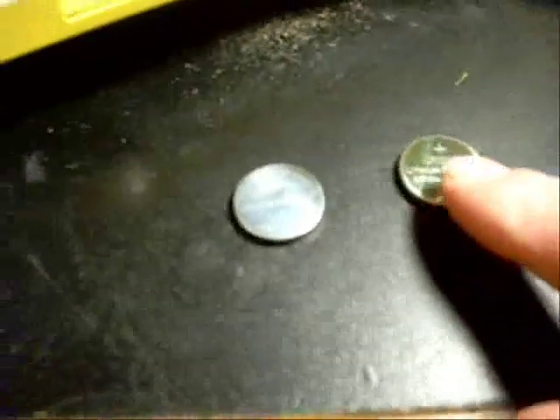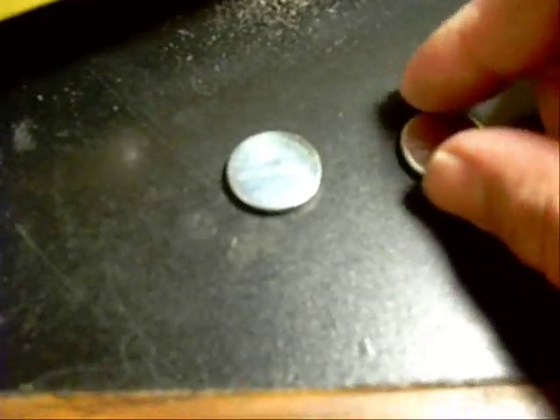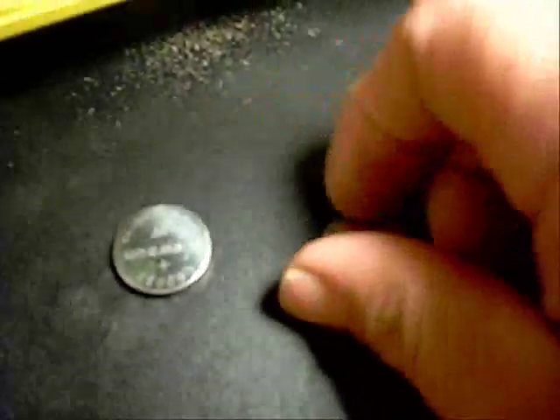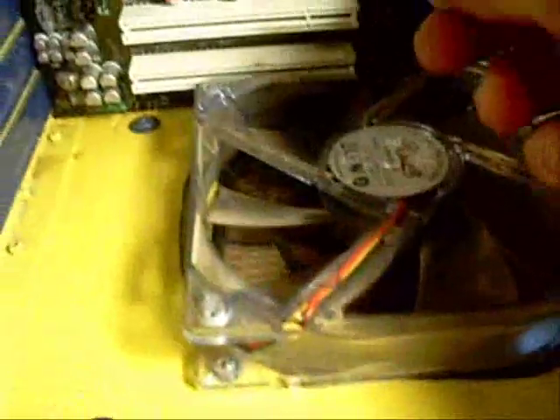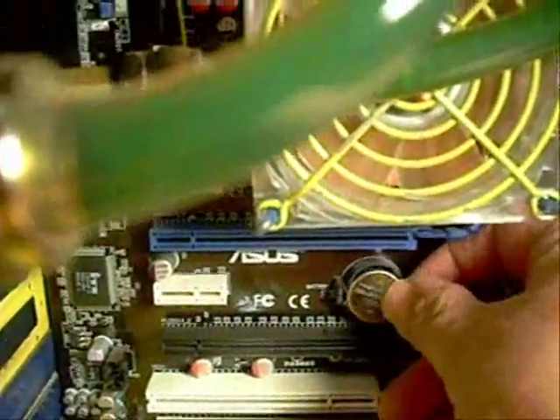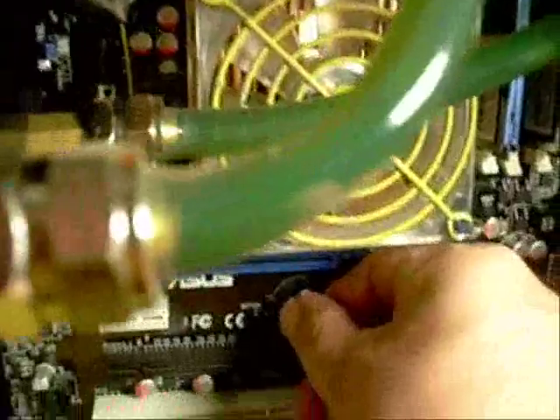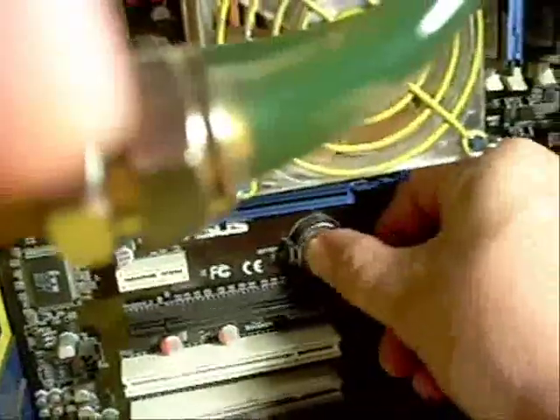This is our new one here. Your positive side is the shiny one with the letters that's facing you. The negative side is just kind of plain. Basically when you put the battery in you always want the numbers to face you — the positive part is going to be facing you — and you just put it in the opposite of how you popped it out. Stick one corner or edge in there and push it in, and it will lock right into place.